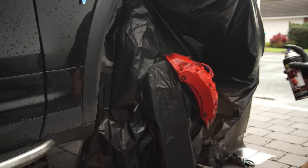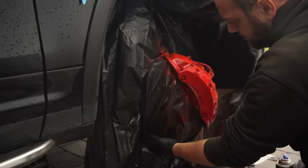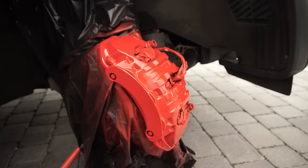As a side note, I started painting these in glorious sunshine and had already done one side. Then, when I came to do this side, it kept raining. Anyhow, onto the second layer — build up the paint a little more and you'll notice that the paint now starts to cover a lot better and is a lot less transparent. The third coat can be what's called more of a wet coat. This is where you get the smooth finish, but it's also where you can get the runs. So carefully build up the finish to a smoother surface, but don't apply too much paint in one area, and this will give you a glossy finish.